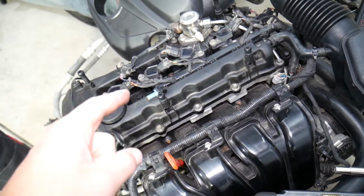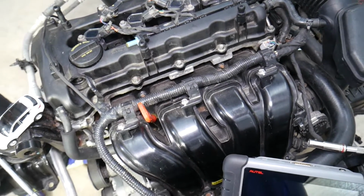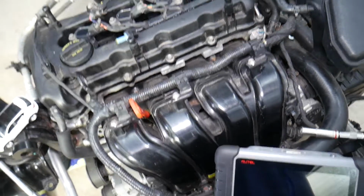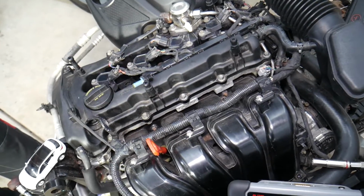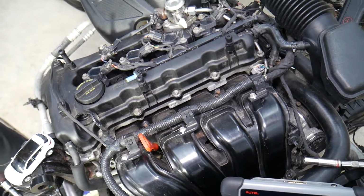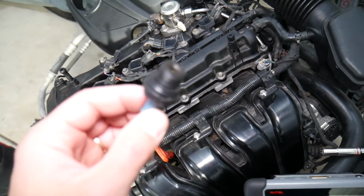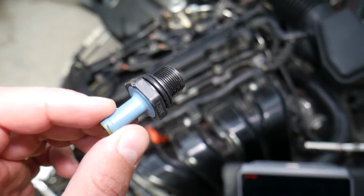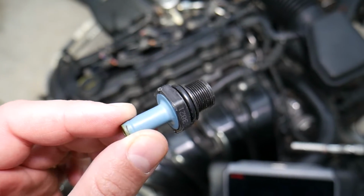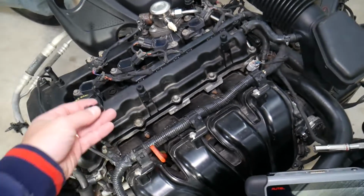Depending on how bad it is, we've seen especially on BMWs, which are more complicated, cases where you think you need a new engine. It will be smoking like a bus. It's crazy, sometimes black on the back, sometimes gray, whitish smoke, and you think okay, it's done. But it's not. All you have to do in some cases is replace that valve. Not always of course, but if you're having increased oil consumption, I recommend replacing that valve, which is very inexpensive, and we'll put the link in the description of the video below.